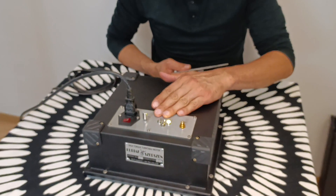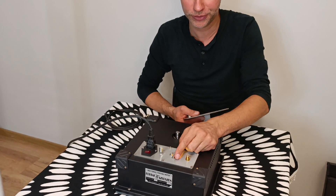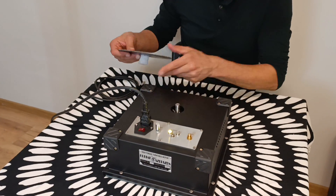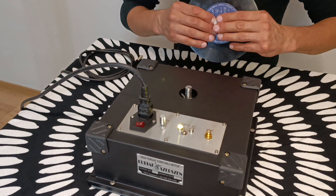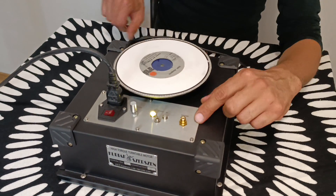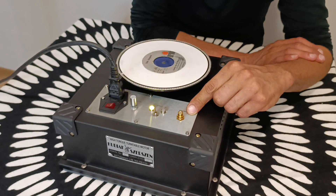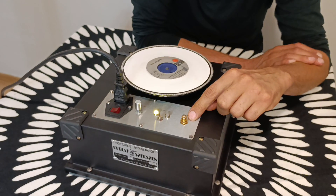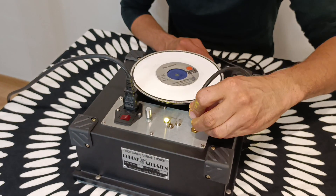To show you how this device works, I'm going to reprogram the 33 speed. Give me a while till it slows down to 33. I'm going to reprogram it to 45. There's an extra in it — it's a strobe that's on 50 Hz for the European market. And if you are in the USA, just make me a note and I will program it for a 60 Hz strobe torch, so it fits your strobe disk.